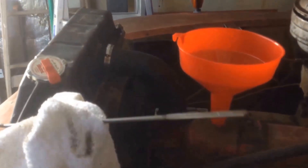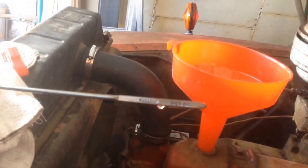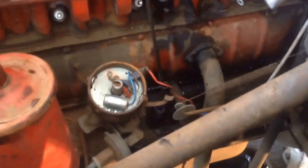Now we're gonna check to see if there's any leaks. I don't see any. Oil fluid right there. We're checking the dipstick to see if it'll fill her up with oil. It's almost at a tie — I think we've got to add a half a quart. Let's check it one more time. That was five quarts. It's just under full. Let's let it settle a minute and check it again.